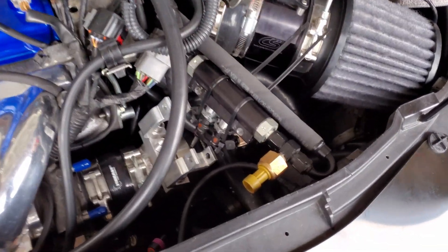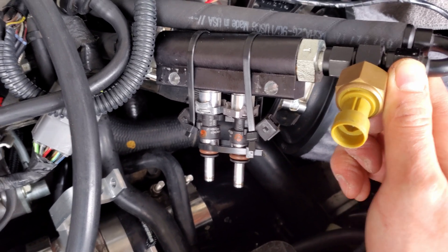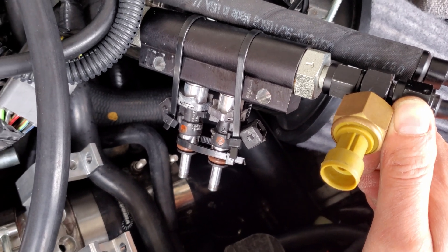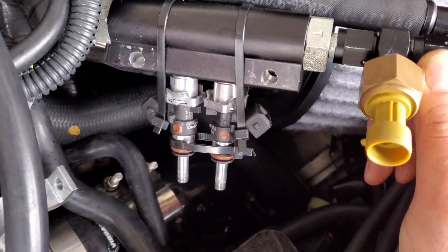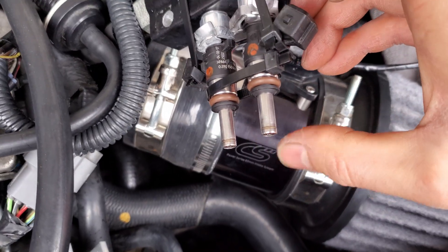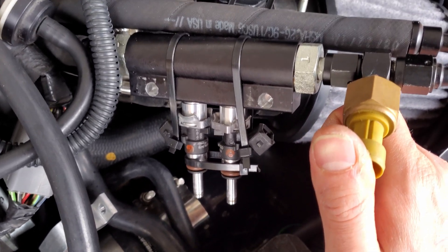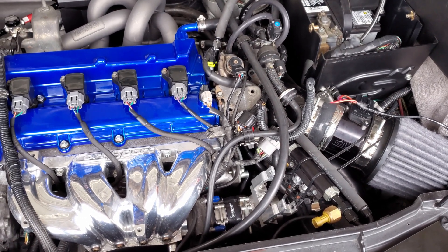So there we have it — we've figured out the minimum pulse width. We could potentially go lower than 1.5 milliseconds, but there's no point. One millisecond is a thousandth of a second — a very short span of time. Since one millisecond doesn't work but 1.5 milliseconds does, I'll set two milliseconds as the minimum pulse width and go higher from there. Luckily the injector isn't leaking anymore — it was probably just from sitting stagnant. The spray pattern on both injectors looks great. I'll put the car back together and soon we'll start tuning — see you in the next video!